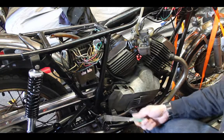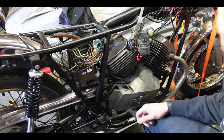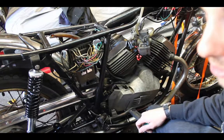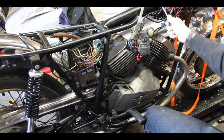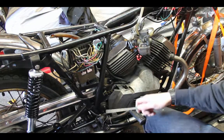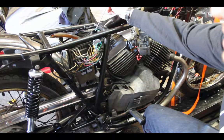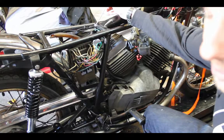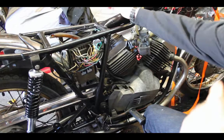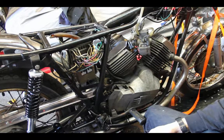Or if it's not hard to come by, meaning you have an aftermarket or custom thing, there's one company in North Leicestershire, UK, that makes them. And that's where I got my replacement after, yes, learning the hard way by putting an ignition key switch in. I inadvertently put 12 volts into the system and fried my transducer, it's what it's called, little black box. And so then I had to wait to get a new one.